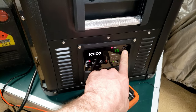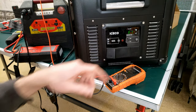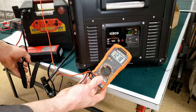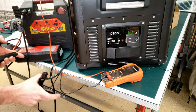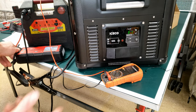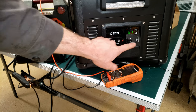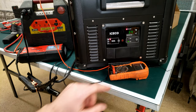I'm dropping this down to zero to make the temperature difference much larger and speed up the test. Four hours later it did finally throw an E1 code — DC voltage below the protection settings, battery protection mode activated, so it's now in safe mode. It shut off at 11.1 volts and should turn back on at 12.4. The battery voltage has crept back up to 12.8, so I'll hook a jump pack back up and see if the fridge turns back on automatically. It did turn on — I hear the compressor going. It still shows the E1 code but once there's enough voltage the code clears itself out. We're at 34 degrees now.